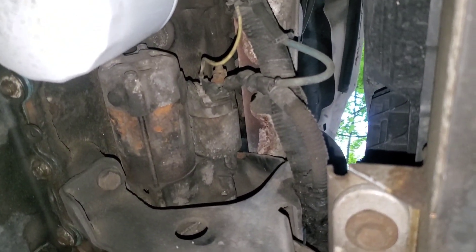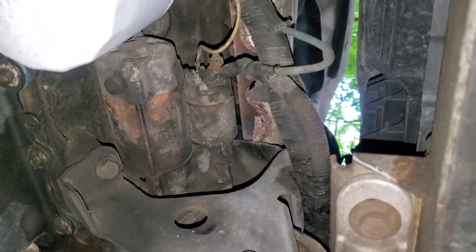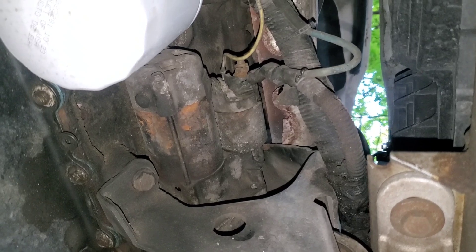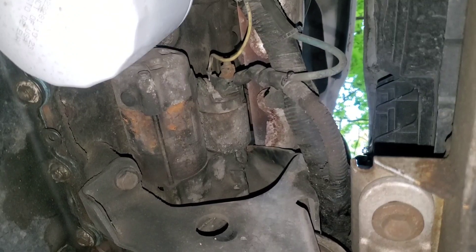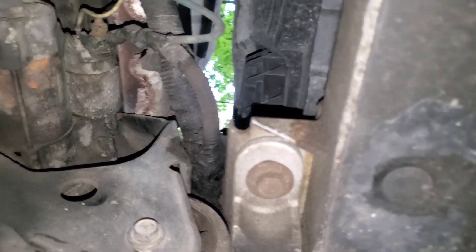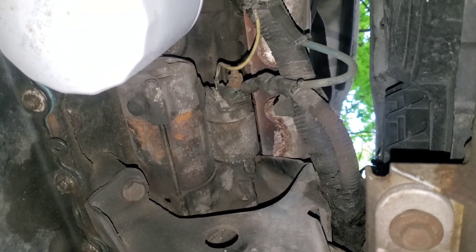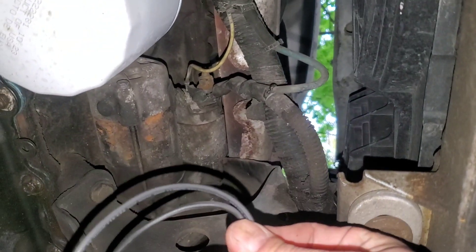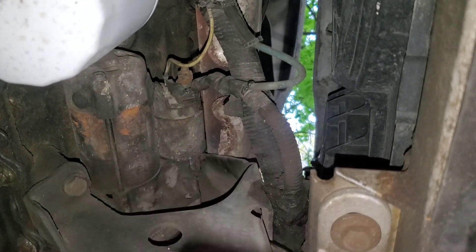As I can see the starter is working, and I know it's working because it's my vehicle. I am interested to know why the gear didn't actually kick out, because it does normally do that. It may be — and I could be totally wrong — that the motor itself doesn't pull a lot of current, but it takes a lot of current to push that gear out. So I'm wondering if maybe these wires just aren't a thick enough gauge and that's what was limiting the power. That's my best guess — but that's a different topic for a different video.